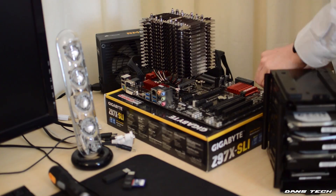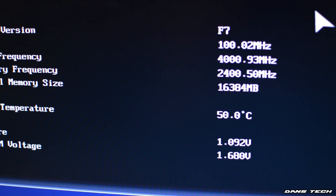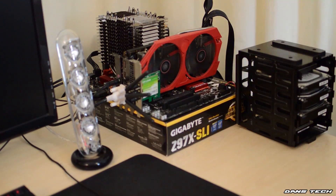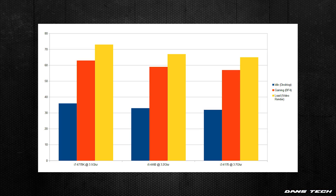I did get it installed and it's now time for the temperature tests. As I turned on my PC I remembered I had a 4GHz overclock on my i7 4770K, so I turned that off as I was reaching 50 degrees just in the BIOS. I dialed it down to 3.5GHz. I also tested an i5 from my mini ITX PC and an i3. I tested this on an open test bench with the room temperature at about 19 degrees. The CPUs tested were: i7 4770K at 3.5GHz, i5 4460 at 3.2GHz, and i3 4170 at 3.7GHz. The i3 has 2 cores, the i5 has 4 cores, and the i7 has 4 cores with hyperthreading, effectively 8.